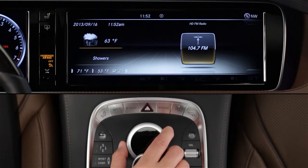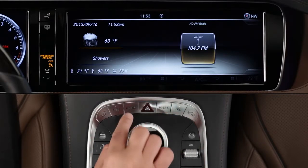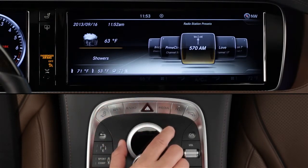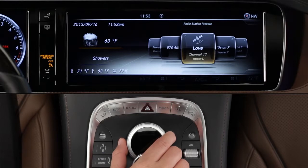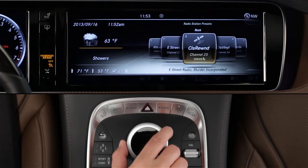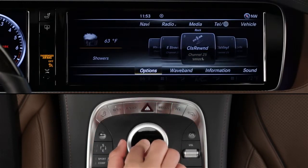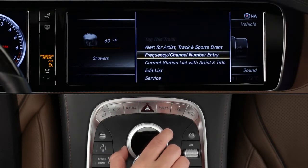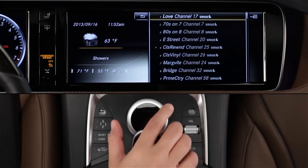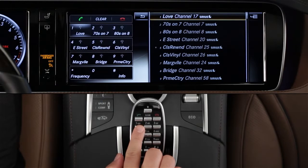There's also a master station list of up to 99 stations. To access this list, select radio presets from the carousel menu, or by pushing the radio button, and scroll through the stations. The first 9 stations in the list are the same as your keypad presets. You can edit or rearrange the saved stations via options in the lower menu for the radio. You can see what's stored in the buttons anytime just by lightly touching them, without pressing one.